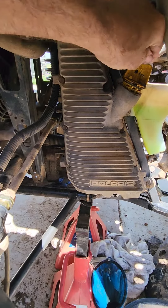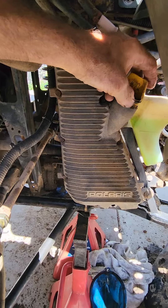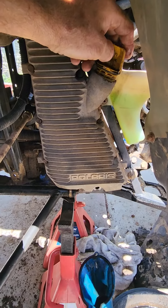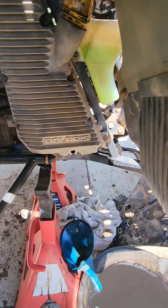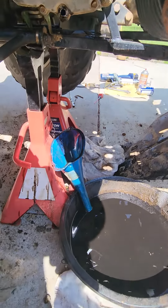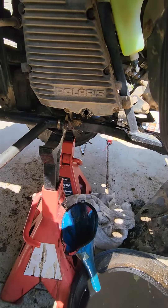Here's your fill. Make sure when you're draining the oil, loosen the fill cap because it'll create a suction and your oil will probably not come out. If you have a problem with it being on jack stands, I just put a funnel down there to catch some of the drippings so it doesn't get all over the jack stands.